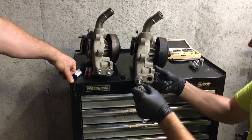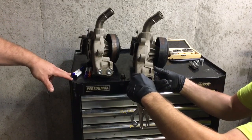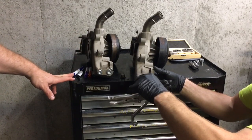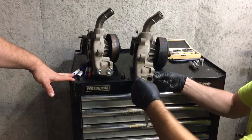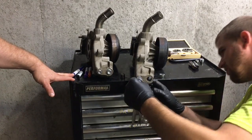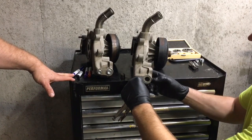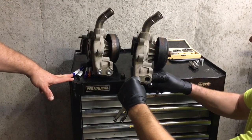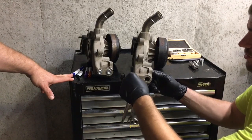What made you come up with this idea? Well, the hot side on the Typhoon was right in the way of these things. So there's a bonus for you guys doing turbos. If you're pulling your hot side over, going underneath your pulley on the front of the engine and coming up by the frame, you can get extra clearance for your crossover pipe by eliminating these outlets. Now, it could be mainly due to the Typhoon because the Typhoon has that cutout for it, so on other vehicles it might not be an issue.